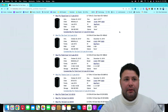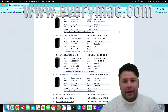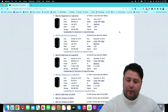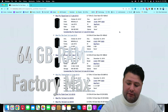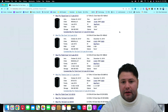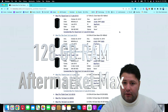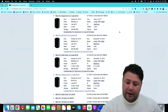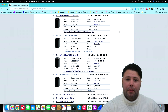It's going to have the same capabilities. You want to read more details about the memory — the number one resource I suggest is everymac.com. These specific units were maxed out at 64 gigabytes when first manufactured, then after some time a memory company was able to get a 128-gigabyte version working, so now you can upgrade one of these Mac Pros to a maximum of 128 gigabytes of RAM. These units have four banks.